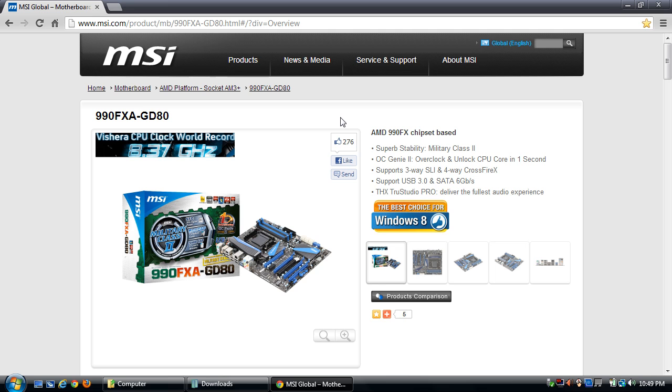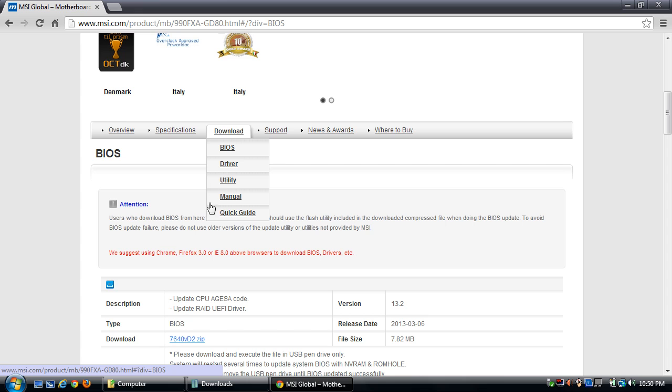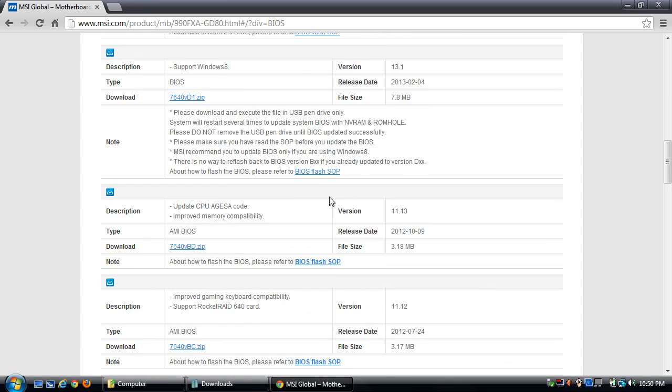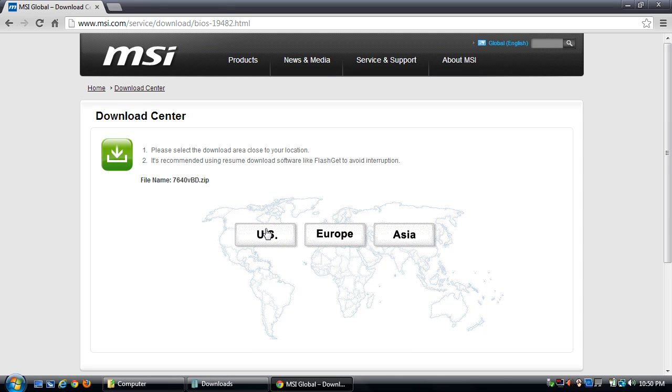Next thing you're going to do is download your computer's BIOS. So what you probably want to do is head over to the manufacturer's website and download the proper BIOS file that you're going to flash with. And your motherboard manufacturer may have specific instructions on how to do this, and I'm just simply illustrating how to make yourself a bootable flash drive and to flash with it. But these are just general guidelines on how to make the drive bootable.